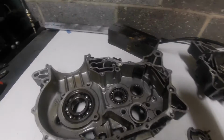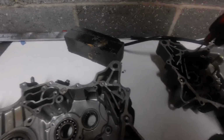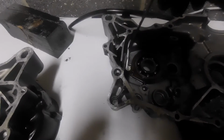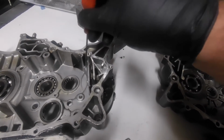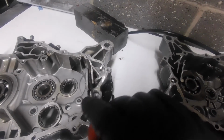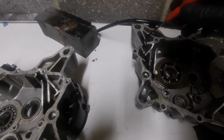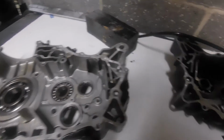So the last note is, obviously we'll have crankcase pressure in here, and in this labyrinth, which is like a garden maze, that pressure inside is building up. The only way past that plate, which is going to marry up to that plate when the cases are bolted together, is through there, which is there and there, up through the labyrinth, which is here, all the way up, and eventually through this little bit here, which would then go into that, and then out the breather.